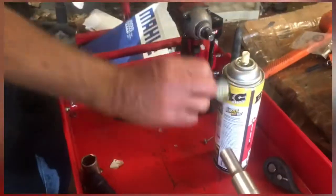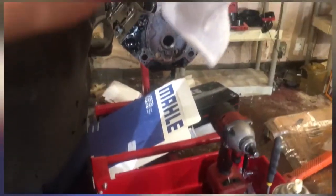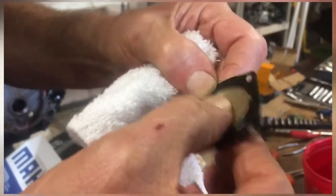All right, man, I'm pulling up to the shop to pick this old carburetor up and see what he's talking about up in here. That's the old one. That was the front pump. That one was still working. It's a little bore. See the rear one? I'm lubricating it until it frees up. See, that one's been in there, ain't been doing nothing for a long time. I put some lubricant on it. The power valve was probably the main culprit.